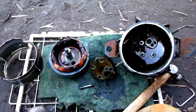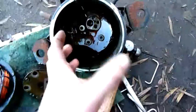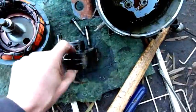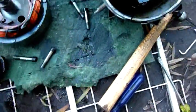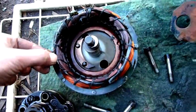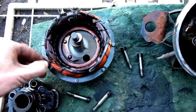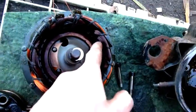Got the stator and its little shroud out. Just wedge a screwdriver in the housing and open it up until you can pull it out by hand. Unbolted the pump assembly which we'll dismantle in a second. That one can go aside — and it's just the housing. The insulation's all broken down and burnt. It's no wonder this thing was running funny and tripping the breaker. There are so many spots where this thing could have been burning up, particularly in there where it's black.